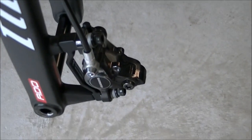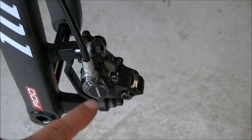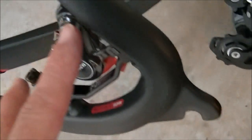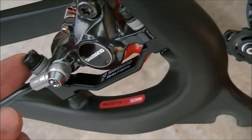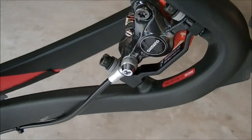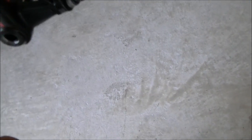I am doing the front brake for this demonstration. It's important to have the brake caliper hanging down as low as you can get it. If you're doing the rear, at this point you would actually undo the 5mm Allen bolts, set them aside, make sure you look at how the spacers are stacked, and let the brake just hang down — you've got to let it hang to use gravity to get the hydraulic fluid through the lines. For the front brake, I'm just going to leave it on the bike because it's already hanging down.